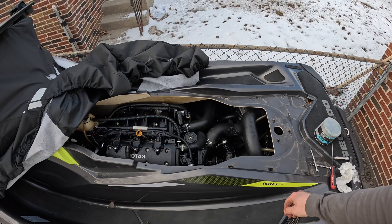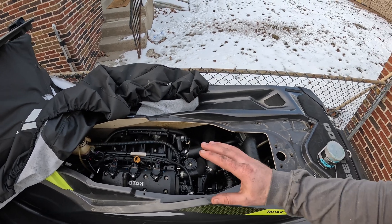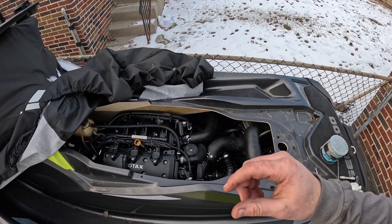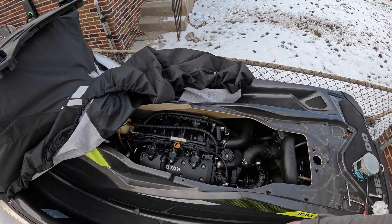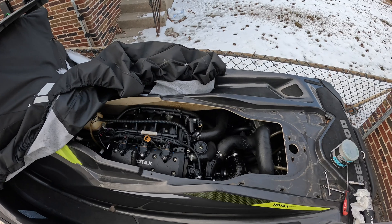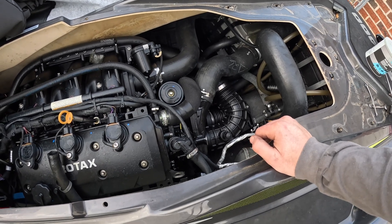We're going to check where it's at and adjust if necessary. If you are beyond 200 hours and the slip is way off, I highly recommend you send it off to get rebuilt or just buy a new supercharger. Because if those slip washers break or any part of the supercharger breaks apart, it's mounted directly into the engine - parts of it can break off, get into the engine, and it's bad news from there. So check your supercharger slip moment at 200 hours, or proactively beforehand.